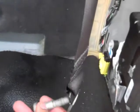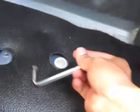Also take off this seat belt, and that'll be another Torx tool as well — I believe it's a T50. Alright, so I finished taking off those bolts. It was a T50 Torx bit to take off that seat belt, here it is. Just lefty-loosey, righty-tighty.